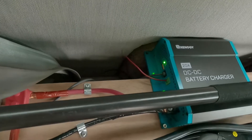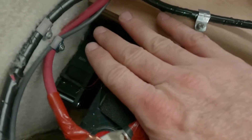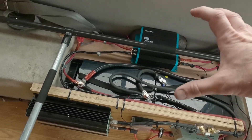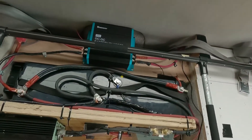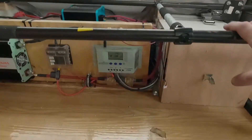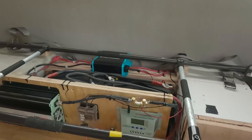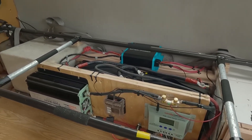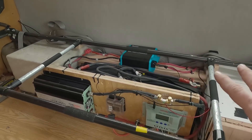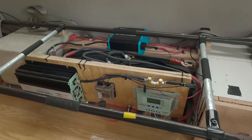We're showing 14 volts right now, actually pulling from solar since the sun is shining, keeping the batteries full. I set the camera up and flipped the toggle switch - you can see the green light is on, indicating we're running. If I put my hand right here I can feel it pulling air. The charge controller now shows 14.4 to 14.5 volts, confirming the batteries are charging. They're almost fully charged so I don't need to run it long, but everything is working.